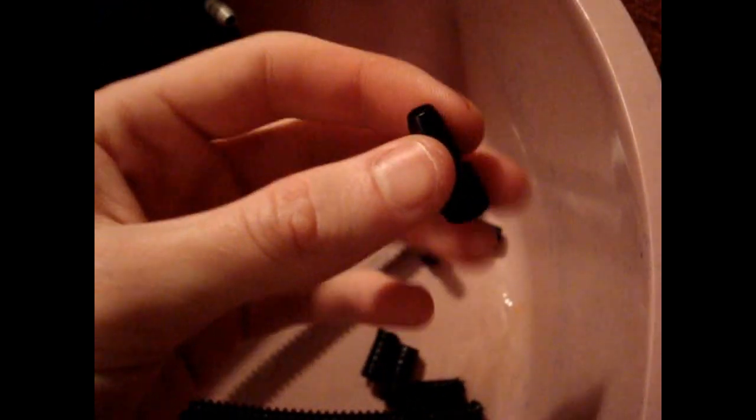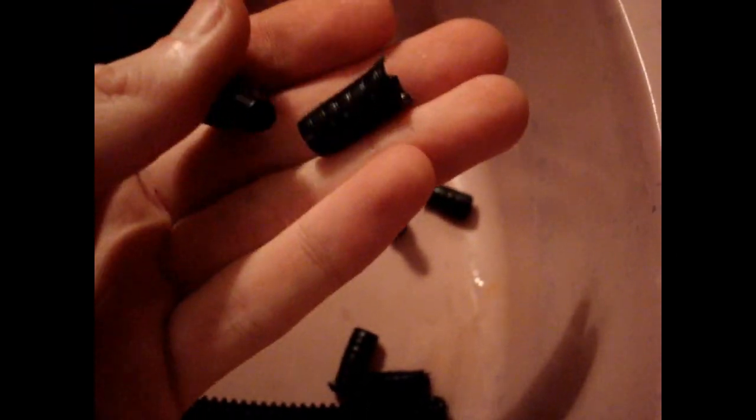Then in order to remove them, you're going to do just like what you did with the radiator cutoff. These are the barbs that are on the pump. You're going to want to cut where this plastic tubing slides over — cut it from the tubes and then slice it down the length of it. You just want to make sure you don't compress any of the barb. I think they're plastic or aluminum — I can't tell.